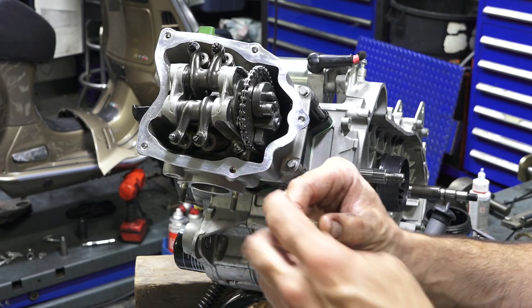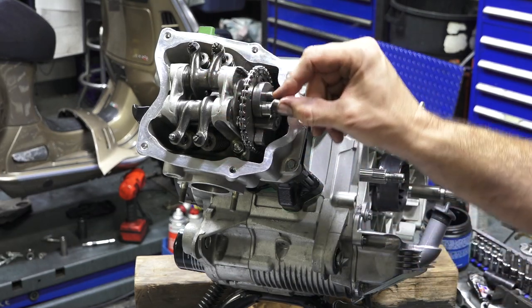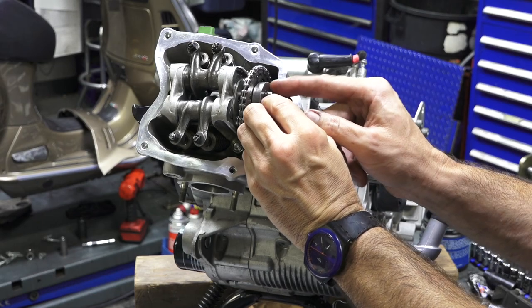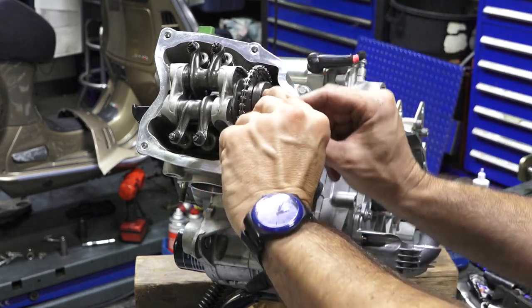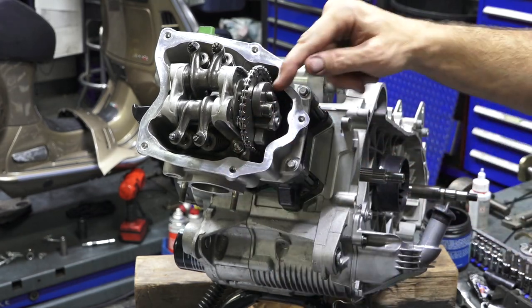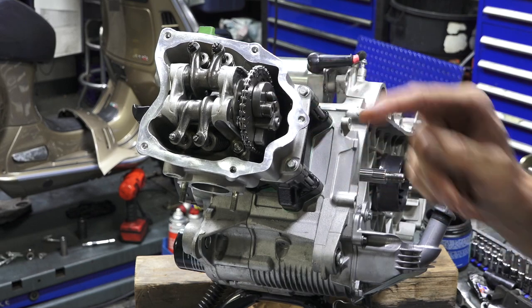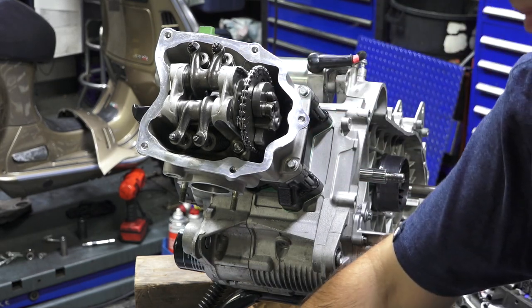Take this spring here, kind of looks like that. Put the spring on, you hook it on this lobe, see how this lobe is movable? And then just bring the little ear all the way around. And it will stay in place without the cover. So you can see the ear here, and the ear is on this lobe here. Here's how to check the operation. Make sure it returns on its own and you're doing good.